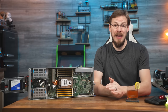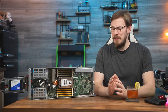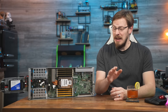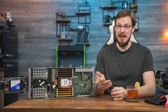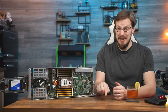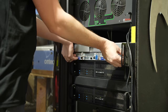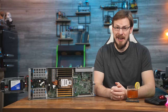If you want to see the full video — and it's definitely worth the watch — the link is down in the video description. While I fiddled a bit with the BMC via the onboard serial port, there were some pretty clear signs that the system wasn't booting properly. Even if video had been disabled by the BIOS, the USB still likely would have recognized my keyboard. That video ended with the server making a lot of noise and not much else. In the end, I asked for suggestions on what to try next, so let's cover a couple of those ideas now.